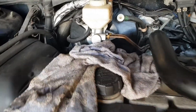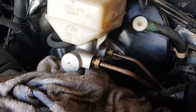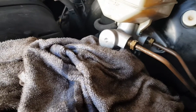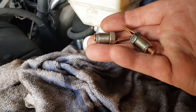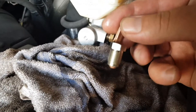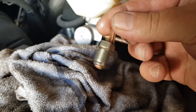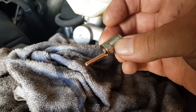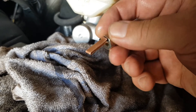So what we're going to do is take those two lines off and bung the holes up with these, which I've made. These are just standard brake fittings, 12x1mm. As you can see, all I've done is get a bit of pipe, flared it over, and bent it over. I'm not sure quite how well that'll seal - we'll see when I put some pressure on it.